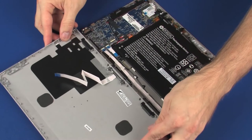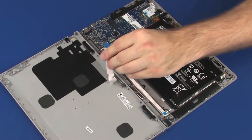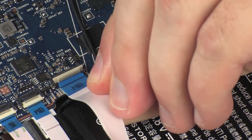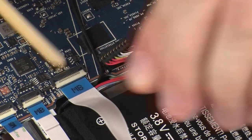Place the display enclosure in front of the display panel assembly so that you have access to the pogo connector ribbon cable and ZIF connector. Insert the pogo board ribbon cable into the pogo board ZIF connector on the system board and press the locking bar down to lock the cable into place. Use care to prevent damaging the ZIF connector and ribbon cable.